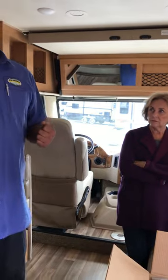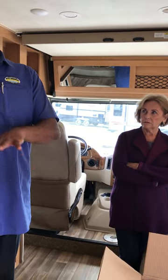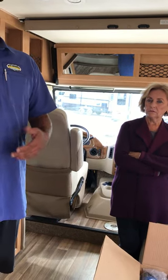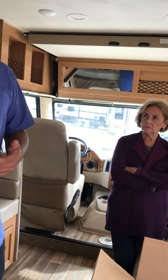Okay, flush it all out. Put water in. You're not going to leave it dirty. What I'm saying is, you don't want to open those valves at the campground and leave them open, because you'll get solids in your black tank and they'll dry in your black tank. So getting them out is near impossible. And you don't want stuff drying on those sensors because obviously you won't be able to read them properly.